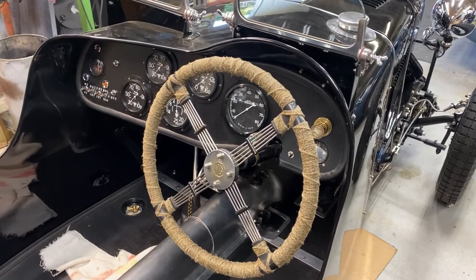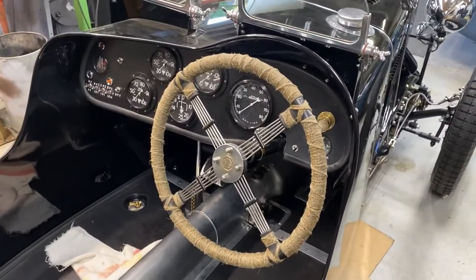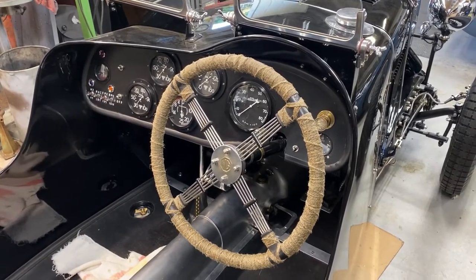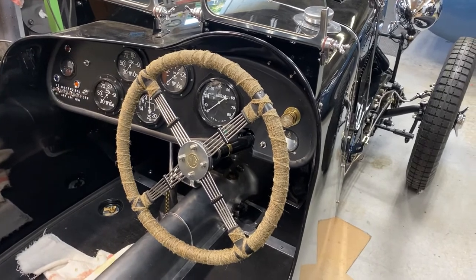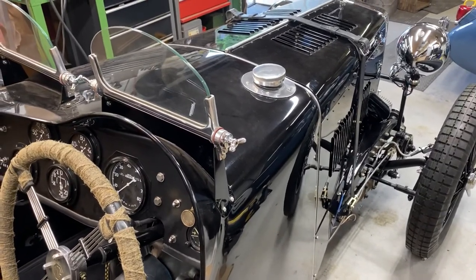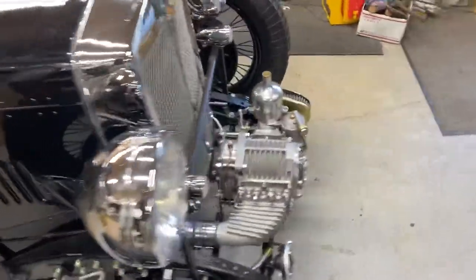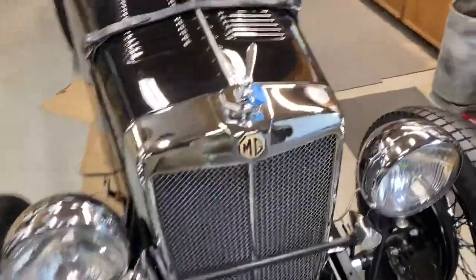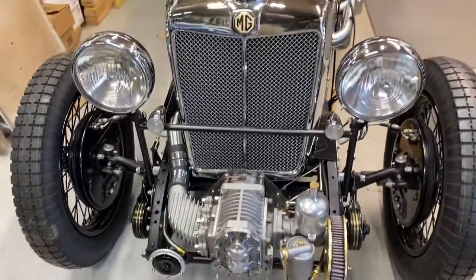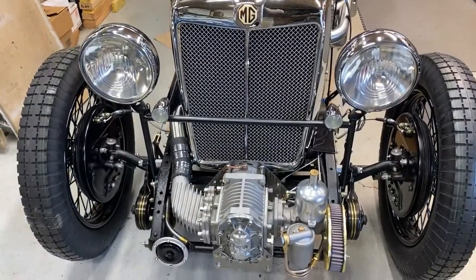Speaking of filling up, it's highly recommended that you don't use ethanol fuels in these cars — it reacts poorly with the aluminum fuel tanks and creates a big mushy mess in the fuel system. All of the racers say don't use ethanol fuel. There's a place here in Tacoma — I think it's Ball Auto Mechanics over by Stadium High School — that has that fuel. It's a little more expensive but well worth it. I have to write notes to myself — needs coolant, lots of things to do still — but it should go pretty quick. We're hoping to start this car early next week, so stay tuned.